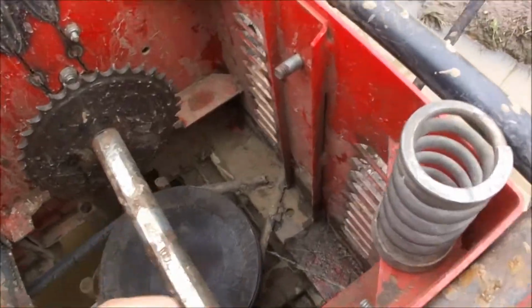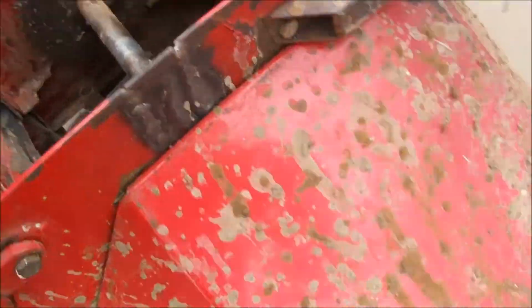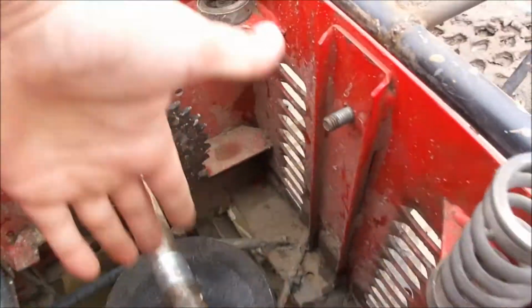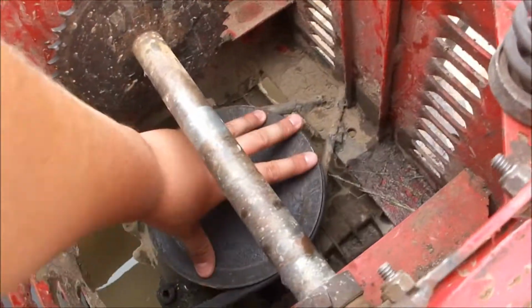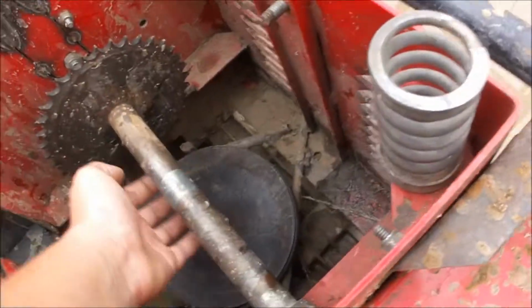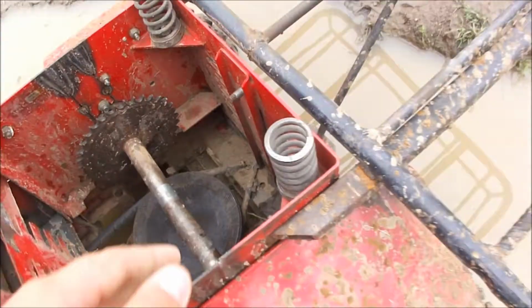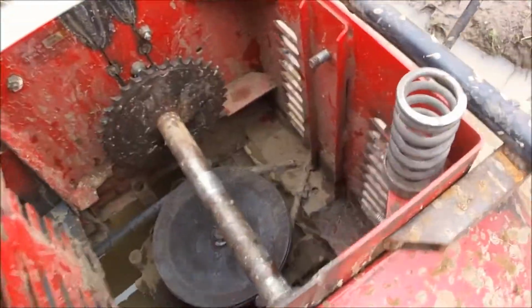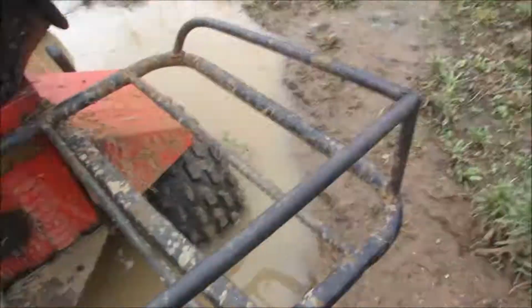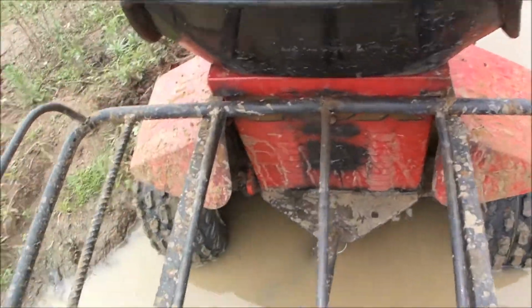Now, as you can see in here, I've still left the original jack shaft, because the way that these Cox ride-ons work is they've basically got 2 drums in here, and then a spindle here with a piece of cork on it that's tapered, and it rubs in between the 2 drums, and it kind of moves on its own, and that adjusts your drive, and then it runs down to a solid rear axle, which is a 1-inch axle that goes to the bottom.